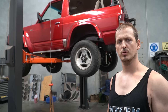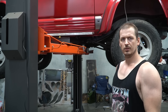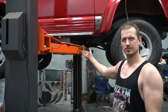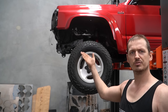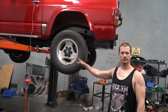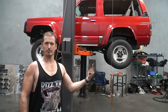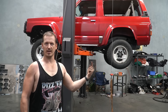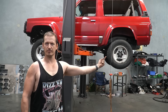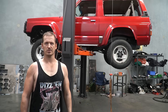Handbrakes. Why do I need to make a handbrake? Nissan Patrols come with one — here's why. Your typical Nissan Patrol has a handbrake mounted to the back of the transfer case. This engine and gearbox combination comes from a Volkswagen Touareg, and the V10 twin turbo has a handbrake built into that gearbox. Since I've removed the Nissan gearbox, I've removed all provisions for the Nissan handbrake. And since I'm using the diffs from the Nissan, I no longer have the provisions to use the Volkswagen Touareg handbrake either. So essentially, I have nothing to use as a handbrake.